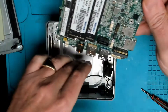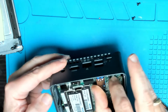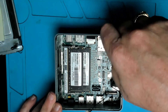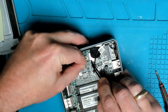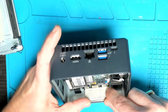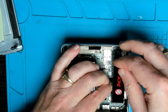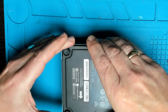Time to slide the motherboard back into the chassis — lift up the cables for the Wi-Fi and for the microphone. Replace the two screws that hold down the motherboard, then reconnect the microphone and the cables for the Wi-Fi card. Place all the foam tape back, then place the M.2 drive. Cover goes back on — tighten up your four screws.